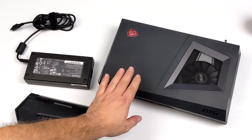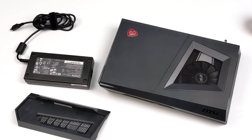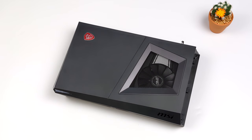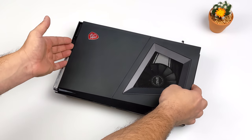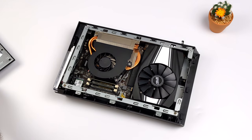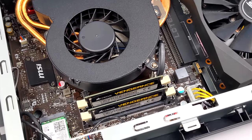This wasn't without issues when I initially picked it up. On the GPU and CPU I was seeing some really high temps, so I went in and replaced the thermal paste on both of those. It also didn't have an SSD — it's got a spot for an M.2 but it's really hard to get to, and there was only a one terabyte mechanical drive installed. The previous owner said it took a long time to boot up, which comes down to everything running off that mechanical drive. So I installed a 512 gigabyte M.2 SSD — it was such a pain to get to, I had to take all the side panels off — and I'm running the OS from that new M.2, keeping the older hard drive as extra storage for games.